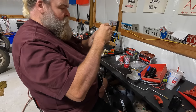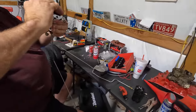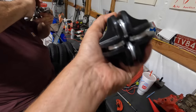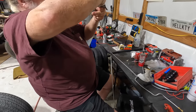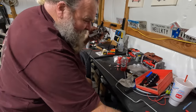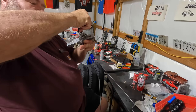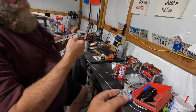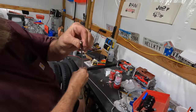Let's figure out how this brake line flaring works. Let's get to it. All right, he's at the point where he's making a flare now. I didn't record the part where he had the cutter — this flaring tool goes on the line and you work it like that. The line is straight as an arrow now. So now the tool — it's just got a pointy tip and it just spreads it out. Right, like that — and that's it. The bends are going to be one of the hardest parts — it doesn't just go in a straight line, it curves around a bit. This tool is the line bender — it basically makes what look like mandrel bends.